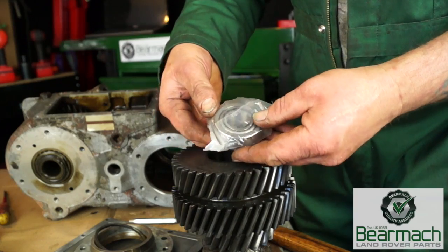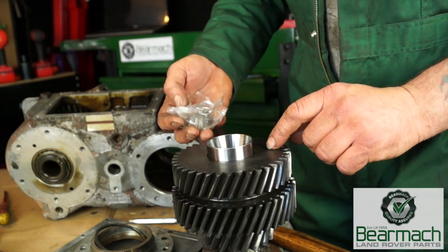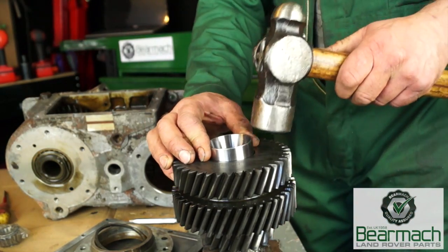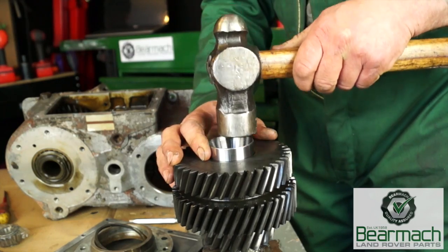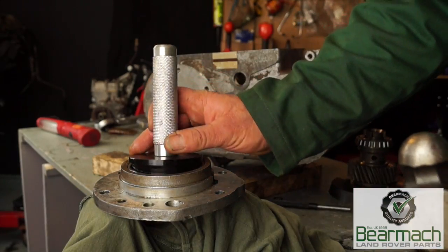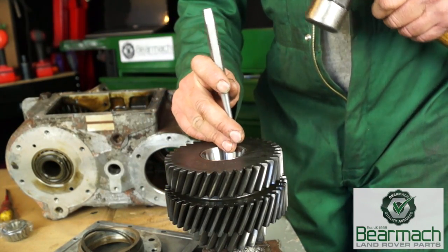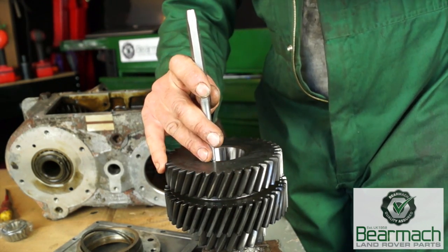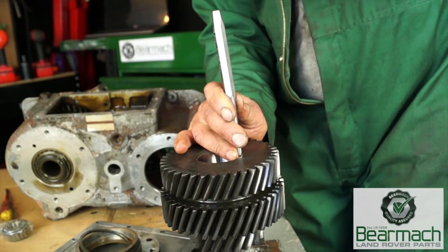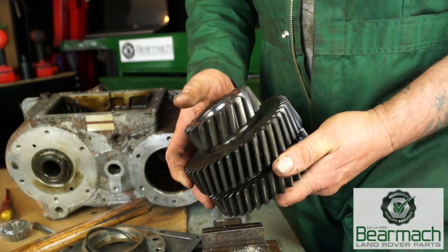Pop the circlips out and put new ones in. As always you have your bearing etiquette — make sure they're clean and stay in the packets until you're ready to use them. This one will be greased before it's put in. There are plenty of ways to put a bearing race in; I'm using the caveman method today — gently tapping the race into place with a hammer. You can use a bearing race driver kit, which are very cheap and excellent to use. Because the races are recessed you need to use something to get them below the edge.